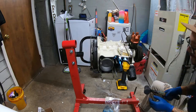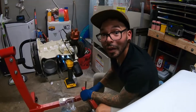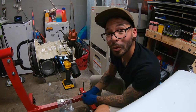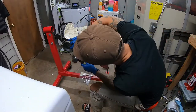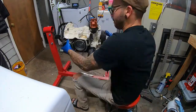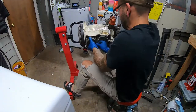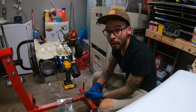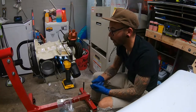Just like that, you have one jug in. Now we just have to do that three more times. I'm not going to bore you with the details. It wasn't too bad coming apart — I think the circlip and pulling the wrist pin out are the two hardest things. Everything else has been pretty simple and things have come out easy, like the oil pump and the crank.